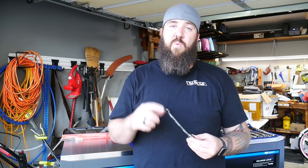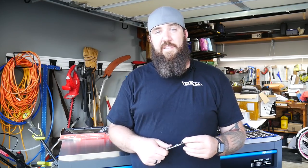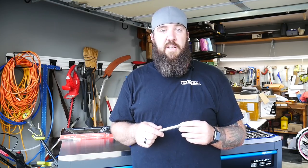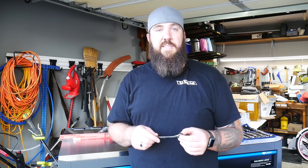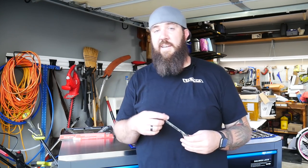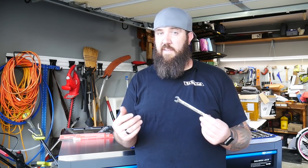When we as technicians start messing around with a lot of these ratchet wrenches, we start off with some of the cheaper ones, but when we get our hands on some of the really nice ones, they just feel that much better. For the money, SP Tools gives you a really good reason to look at both of those areas. This 8-piece 15-degree offset set is actually only like $120 — holy crap, that's less than what GearWrench costs. The ratcheting box end is a 72-tooth design, and if you've used ratcheting wrenches for any amount of time, you understand the feel. The ones that take most of the turn before they start clicking are just absolutely horrible, especially in tight places — underneath the dash, in tight engine bays. These ones will not disappoint you. At 4 degrees, plus or minus 1, on the turn radius before it clicks, that is a really awesome range.